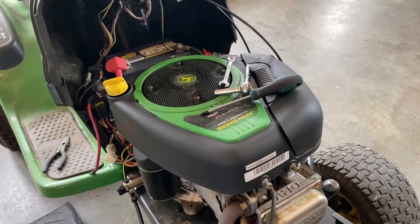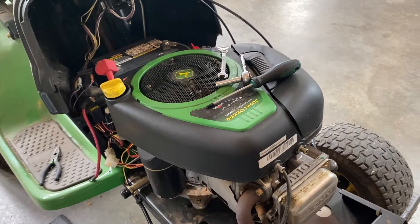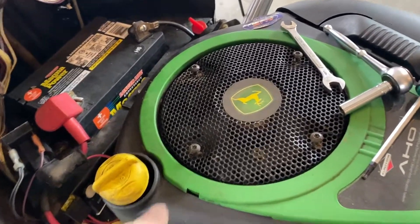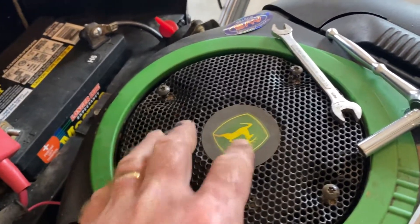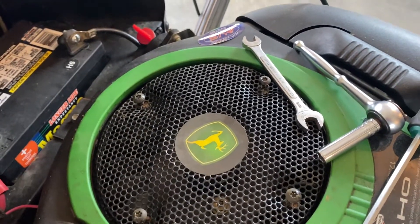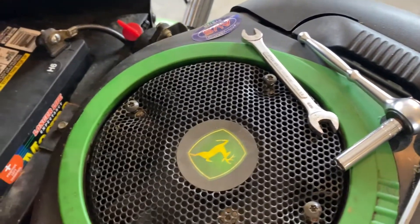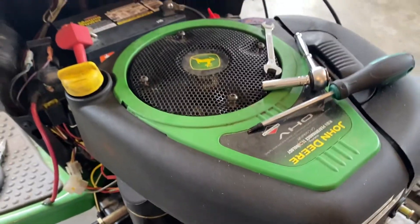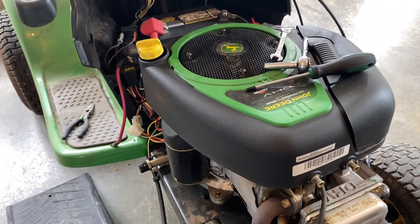We had a brief hiccup that we can fix through the magic of video editing. What we're going to have to do is remove this entire upper cover anyway, because once you loosen the four bolts — these are Torx T25 — the cover has to come off for you to get this plate off and get access to the nut for the crankshaft. To get the cover off, it's very simple on these. There are two 10-millimeter bolts at the back on either side and two at the front that are Torx. Once you undo those, take the air filter off, the cover will pop off and you'll have access to the crankshaft bolt.